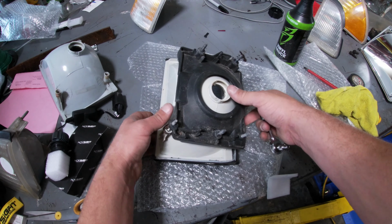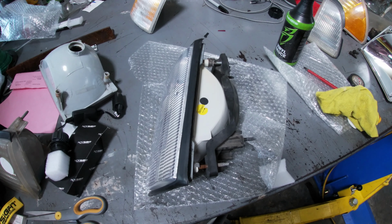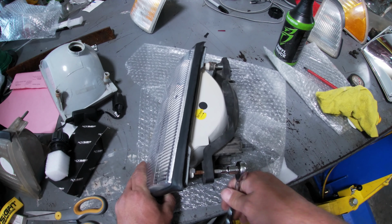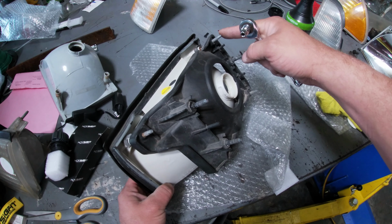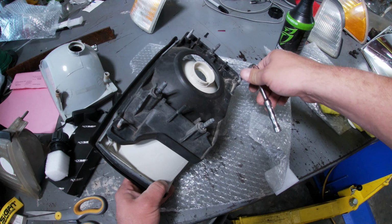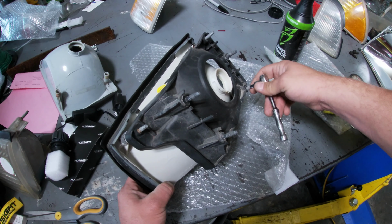Almost forgot. One of the steps that often is missed. When you put this headlight in, you know, the beams from different lamps have different patterns on them. If you don't like the way that your lights are shining once you install these screws right here, just turning them changes the direction. You've got three alignment screws. One, two, three. You find your socket that fits it. I won't say what size because these can be aftermarket ones. I don't know. This car's had a few different sets in it.